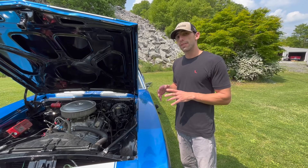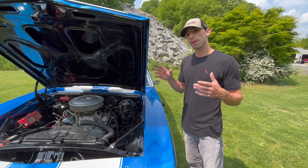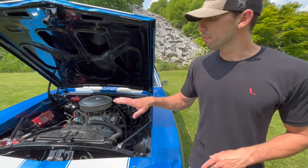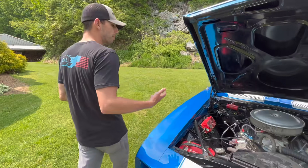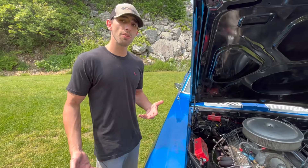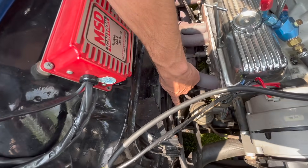The owner of this car does have the original engine, but this is not the original 302 that came in this car — we'll take a look at what an original 302 DZ motor looks like in just a moment. On this side of the car, all Z28s came with a fuel line that is three-eighths of an inch thick. They didn't come with two fuel lines, and this is about the correct size of what it should look like.